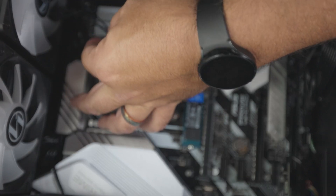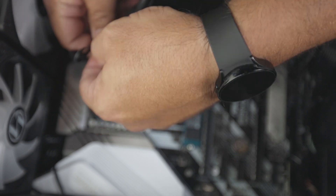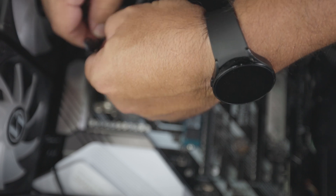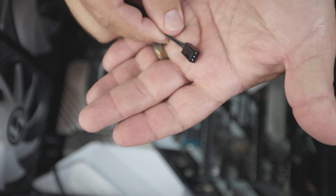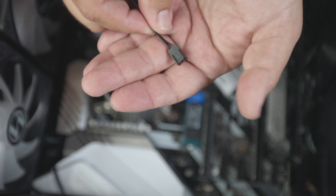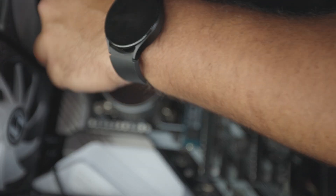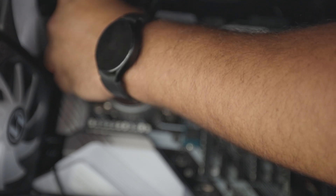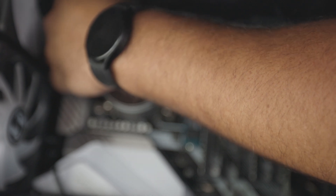What I have left to do is connect the three-pin power header to the four-pin fan header on the motherboard, which is this one right here. Just notice which way the keyway goes — you can see it's got the slots there. On the four-pin connector there's a plastic piece where those slots will go in. You want to line them up, and that's where it connects. On mine, you're going to take the three pins and they go to the outside right three pins — leaving the very far left one unconnected.